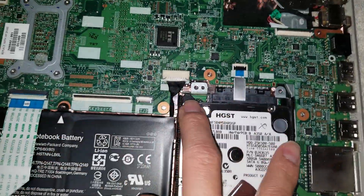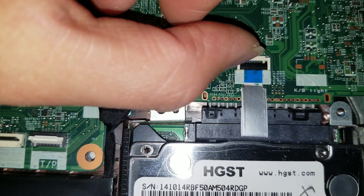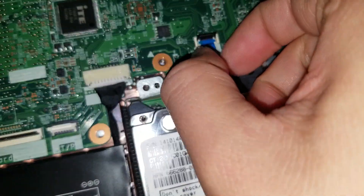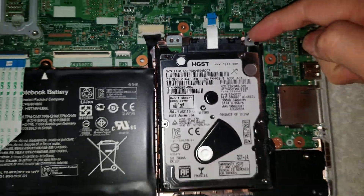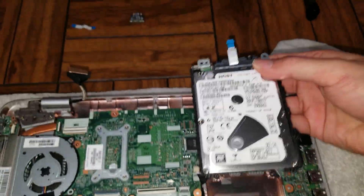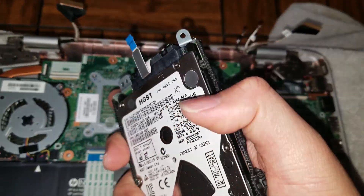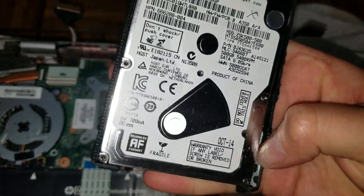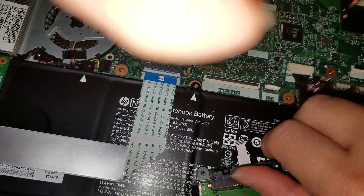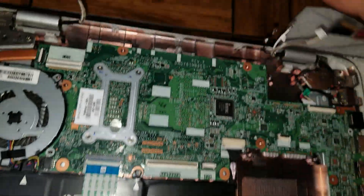Next is the hard drive. There are two screws here — remove those, then flip up the latch. You can pull the drive up. To remove the hard drive, use the metal tabs that were held in by the screws to lift it, then slide it forward and out. These brackets have no screws; just pull them aside. To remove the SATA connector, pull on the plastic piece carefully so you don't damage the cable.